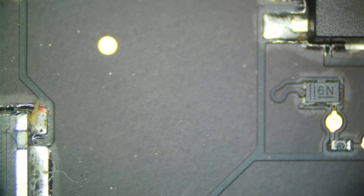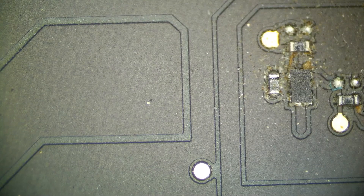Our differential diagnosis for PM sleep S4L could be several different things: a bad clock chip, an issue anywhere within the PCH support circuit, an issue with U1950, S5 rails not coming on, or even a dead CPU. There are so many things that can cause this.